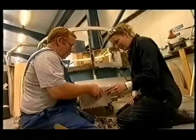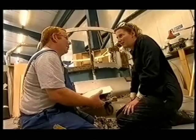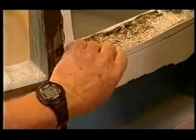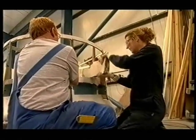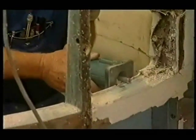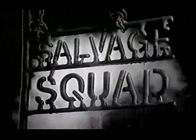It's a real bodge and actually quite dangerous — if some of it had dropped off and fallen into the prop it would have done mega damage. The break in the duct has revealed shoddy repair work: it should be made of lightweight plywood but it's been repaired with decorator's filler and newspaper. If this filler had shattered it could have wrecked the prop and sent lethal shards flying. It means a complete rebuild of the duct — something we hadn't counted on. We've really got our work cut out now.